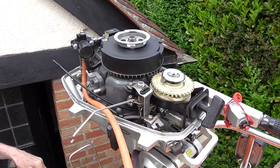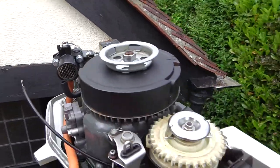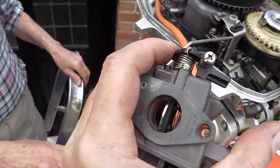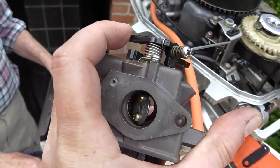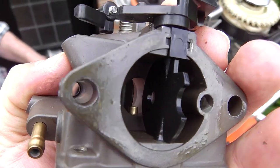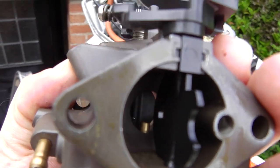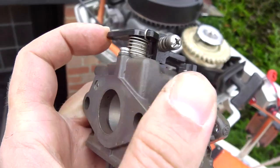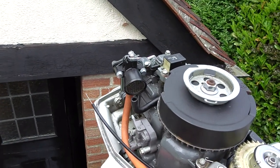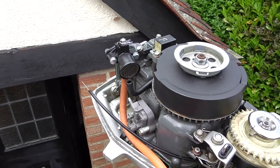Yeah, it might just be burning too lean and damaging things — might get too hot, might burn the valve seats. Because we've now got no throttle. The throttle normally controls the engine speed by controlling the amount of air flowing over the top of this jet, and that controls how much fuel gets sucked up by vacuum pressure in this tube. So normally the mixture is roughly constant and the volume is controlled — more suction, more fuel. But this is as much air as the engine can get, plus a variable amount of fuel. So will that burn? Will it be bad for the engine?